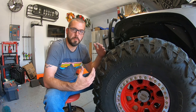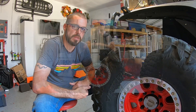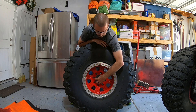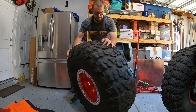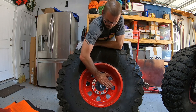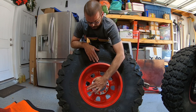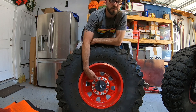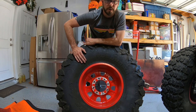With 40s and a 17-inch, there's a bunch of different tire manufacturers that make that size tire. As far as backspacing is concerned, I ran 3.75 inches of backspace. Here's the spare tire — backspacing is simply the distance from the mounting surface that mounts against your hub to the inside part of your wheel. Mine are 3.75 inches, and that moves the wheel out far enough to where you still have a nice drive quality, but it also allows the inside sidewall of your tire to clear all your steering components.